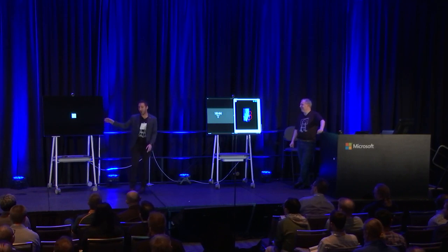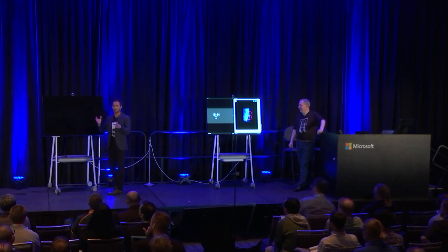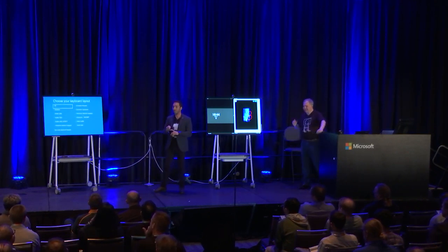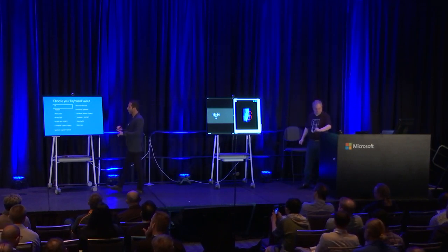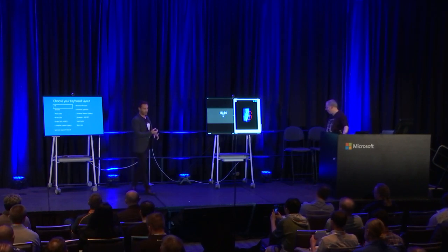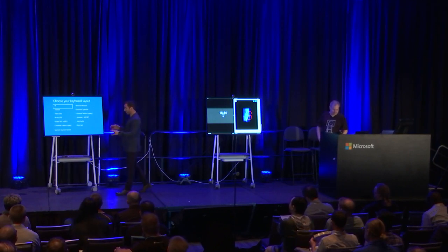If by this time you're not seeing those dots, if you see the OS starting to load, it's probably that the image that you put is corrupted, you didn't copy it right, or that you didn't format the disk with the right file system. Remember, it has to be FAT32, and you have to push whatever image you have onto the root of the thumb drive. Otherwise, it doesn't work.